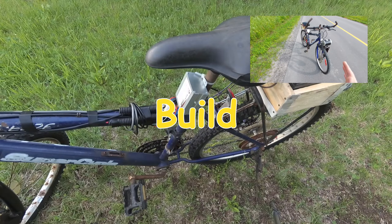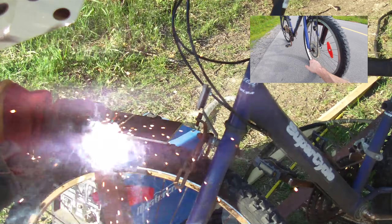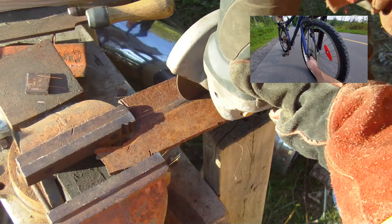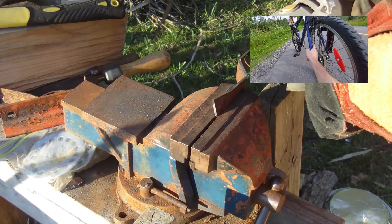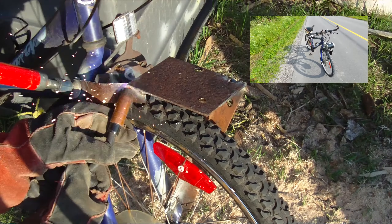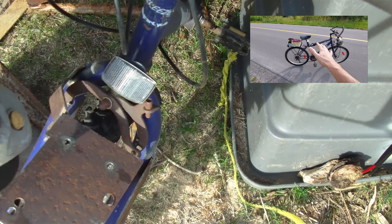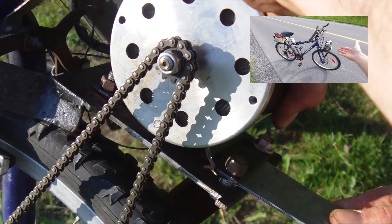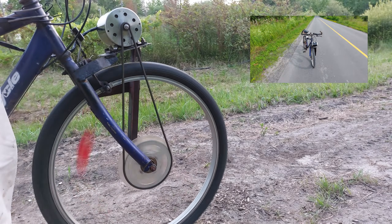If all you have is a chain-drive motor and you want to build an e-bike, this system here — all you have to do is get a rear wheel off a bicycle, take off the cassette, thread on the freewheel, and then put your sprocket on and it's done. Take your cassette off, take the spacer out, and you really don't have to widen very much — but of course you have to have enough width between the chain and the fork. I'm probably going to build a faster bike eventually, but this one right now is my fastest bike and it's still in the experimental stage. It'll also be pretty cool to see what this thing can do in the winter, because now it's basically two-wheel drive — as you're pedaling you can apply some power to the front. I'm not sure if there's going to be an advantage to this, but it'll be crazy to see.